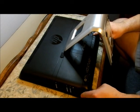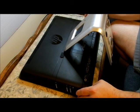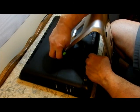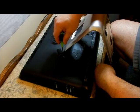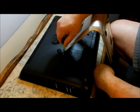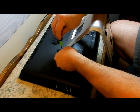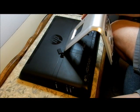The HP model number back here is MS227. We're going to take the hard drive out first. There's a rubber thing here you want to pull up and pull aside. There are two screws in there — one is for the cover, and the other is to take out the CD-ROM drive. We're taking this top one off first. There's a lower one and a top one; the top is actually the shorter of the two screws. Power is off and we have our monitor on a cushion.